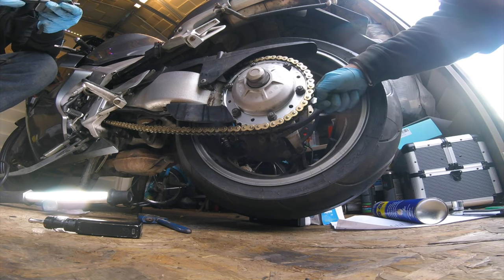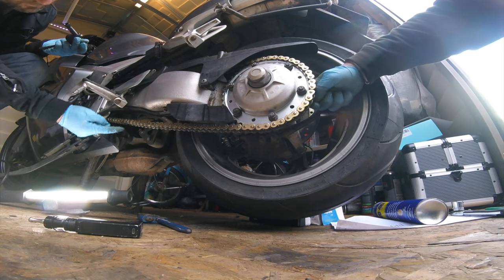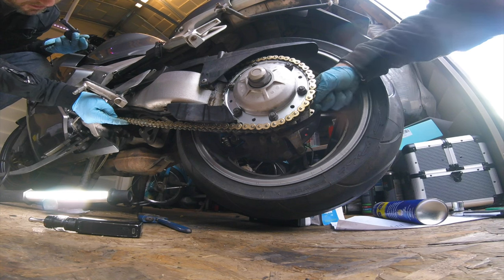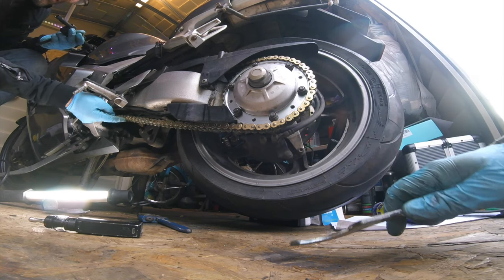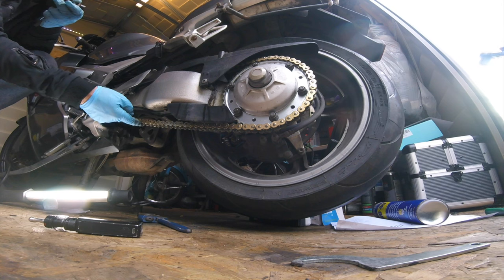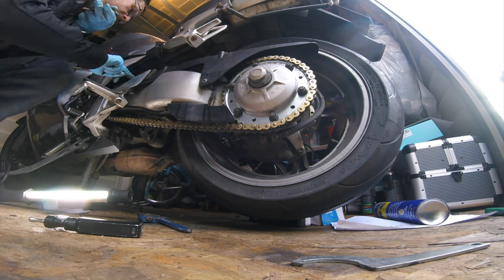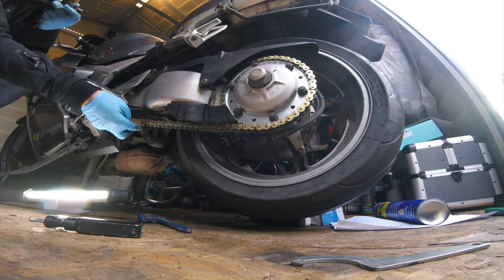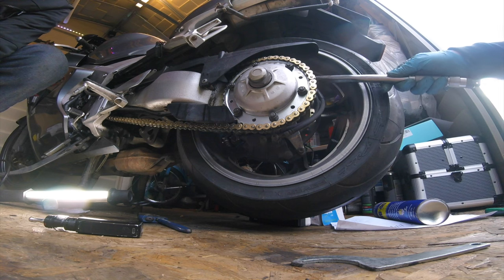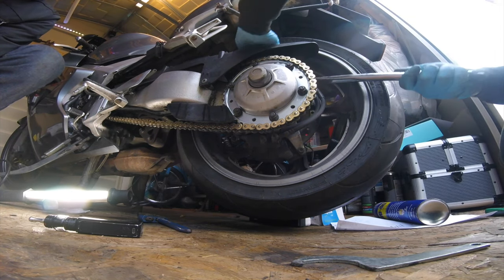Check the chain - a bit more, yeah, a bit more - stop. Little touch - stop. Yeah, free play - one and a quarter inch. It's 25 to 30mm, or one and a quarter inch free play - it tells you on here. Yeah, that's about one and a quarter. What's that - only 70-odd miles, 74? This pinch bolt - it's only a pinch bolt - wheel bolt, I can get that in now.